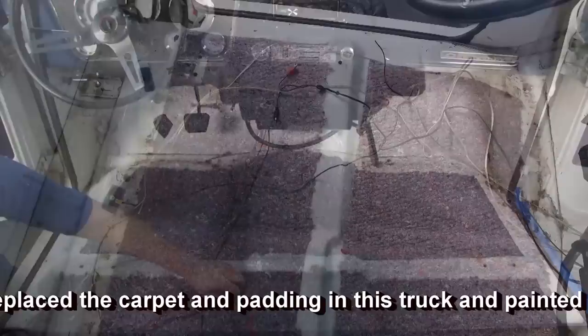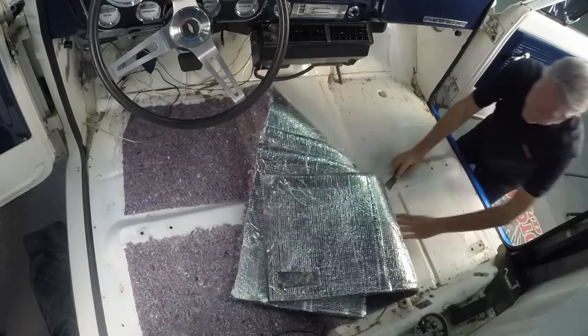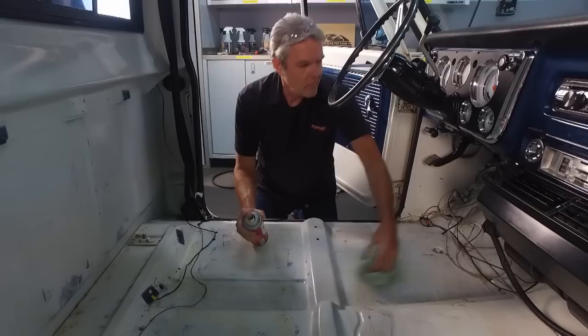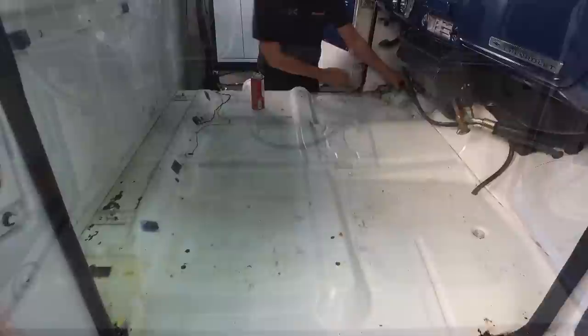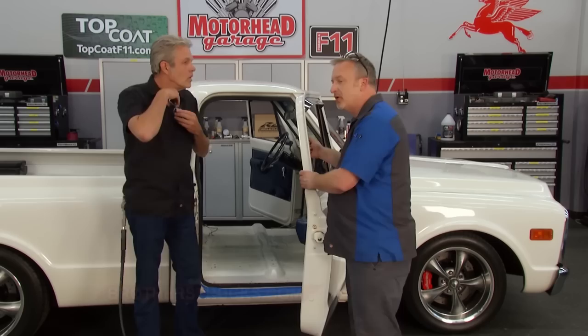I thought we would pull that carpet up and just see a gooey mess, but normally you'll find glue, rust, all kinds of stuff down there. What you want to do is clean that up really, really well, because we're going to be sticking on some sound deadener and sound deadener does not stick to dirt, rust, and everything else. So we get in there and use degreaser — but degreaser also doesn't like to stick, so after that I like to use a wax and grease remover. In a pinch you can use carburetor cleaner or brake cleaner. Then blow it all off — it has to be absolutely dry for the deadener to stick.